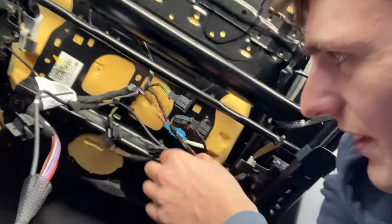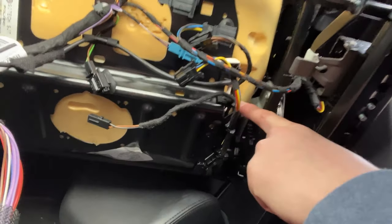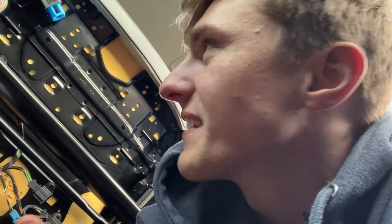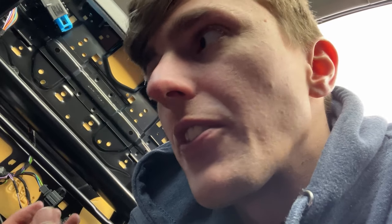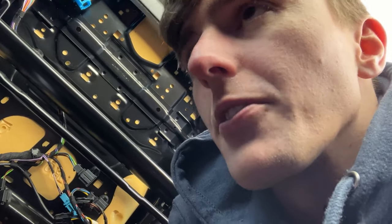I've realized there are actually two sections of wiring — there's a piece that goes up into the seat, and a black wire that goes into the seat back that you can't disconnect from this point. I'm not going to strip the seat down to take off those two wires; I'm guessing they're probably safety-critical wires, which is why you can't take them off. So the seat plan is scuppered and I'll just leave this seat in. On top of that, it means I won't have any airbag lights on the dashboard — I'm not sure about scrutineering, but the scrutineers checking your car before you race might say you've got an airbag light and need to prove it's safe. So it kind of makes me happy I can't take it out.